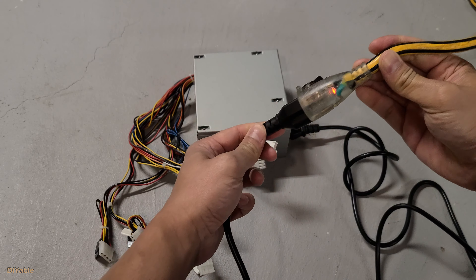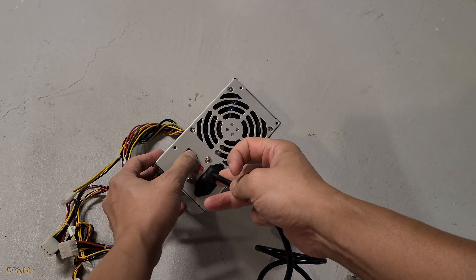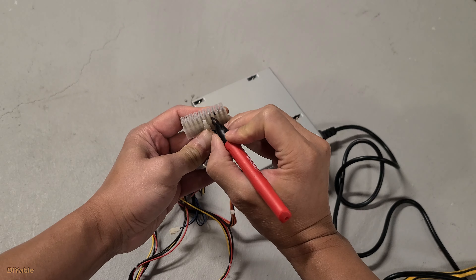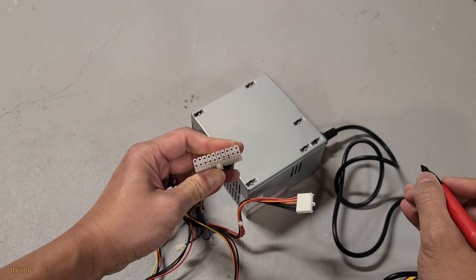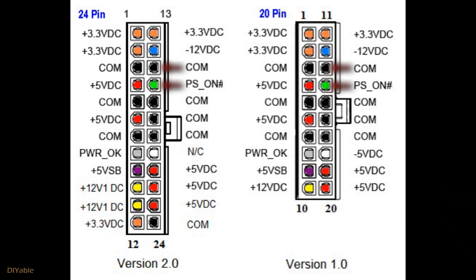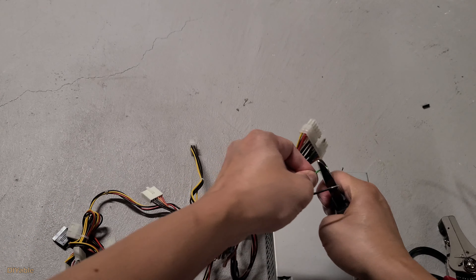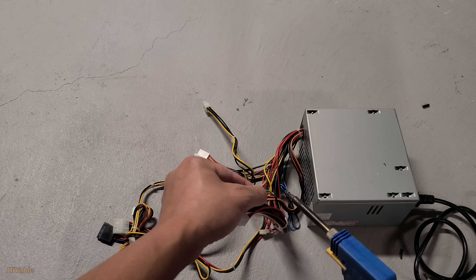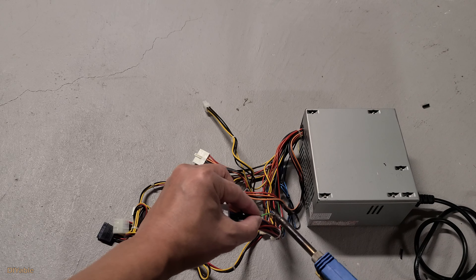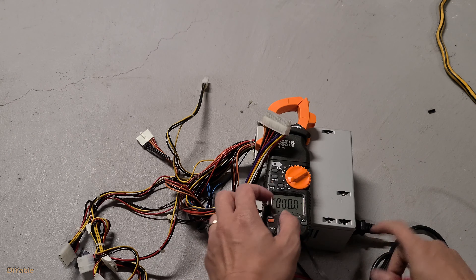Let's get back to business. To turn on the desktop power supply, you cannot just switch it on like that — it won't start. You have to connect two wires on the 20-pin connector: the third and fourth one from the right with the plastic latch facing towards you. It's the same if you have the 24-pin connector, and you can confirm this by looking at the diagram. All we have to do is cut off those two wires and connect them together. To make the installation look professional, do some soldering and then use heat shrink wrap to protect the wires.